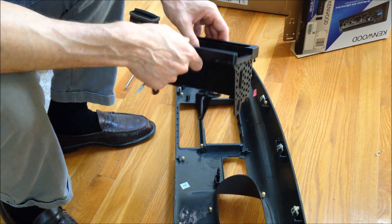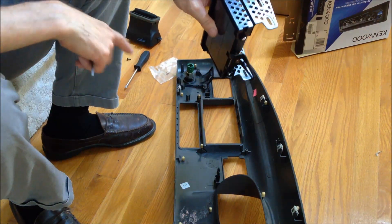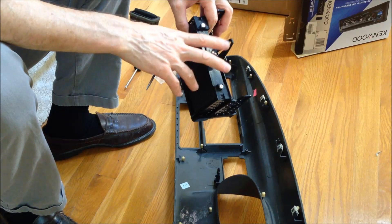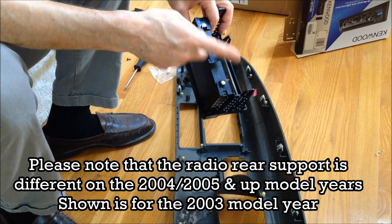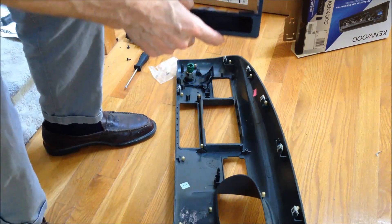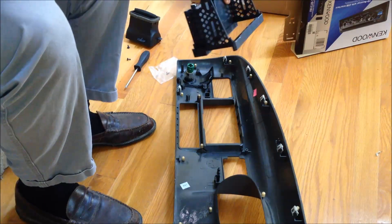After going through this several iterations, I'll walk you through how to get this all together. What I ended up doing is taking out the vents — you need to do that to be able to screw everything together. The first challenge is getting this inside the little receptacle, or the mounting hole on your dash trim panel. It's best to have the face plate off when you screw this all together. I've got my hardware and I bent it to allow conformance to the radio using a heat gun — you can cut it off with pliers too, but I opted to bend it to keep more structural integrity. A little bit of a learning curve here.